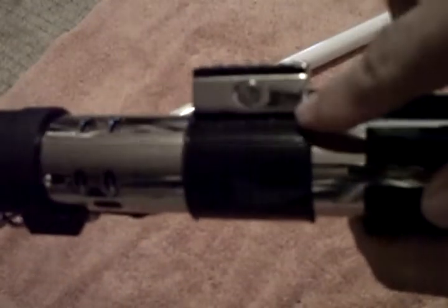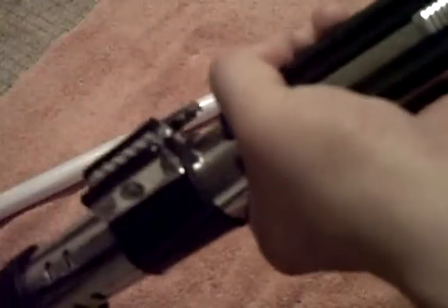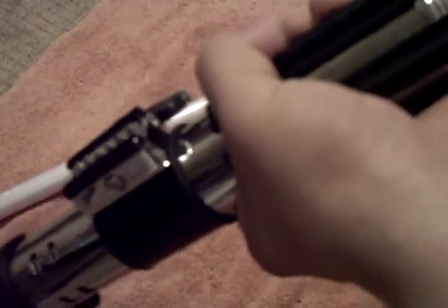This screw here will allow you to remove the entire switch assembly. Inside will be a switch with some wires running down through a hole underneath this secondary cover for the actual handle itself. You will either have to cut the wires to the switch — there are two wires running to it — or remove the solder joints, which is what I did. The electronics module is just the battery, the actual sound card and speaker, and the electronics are in here.